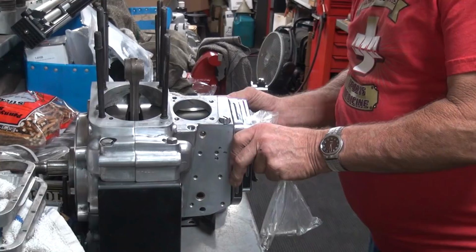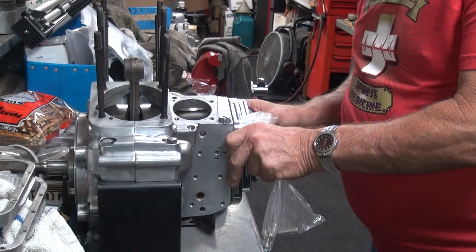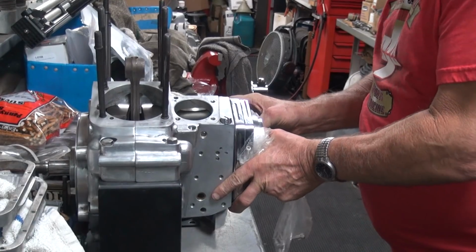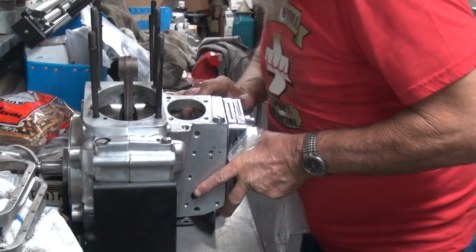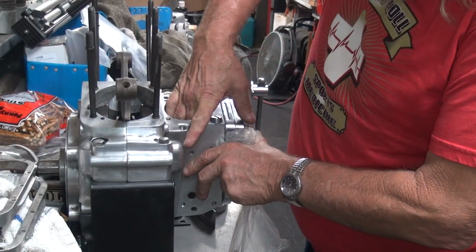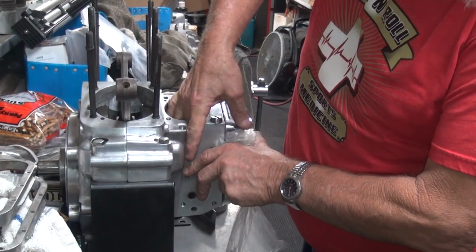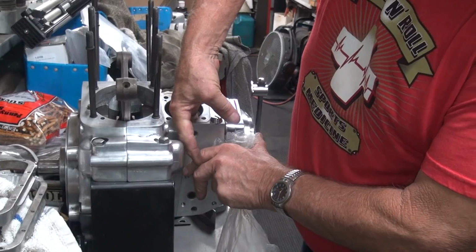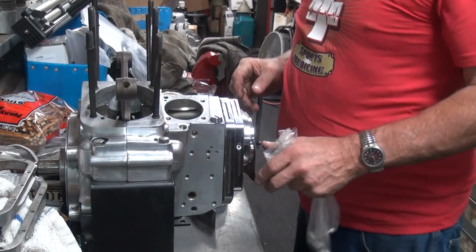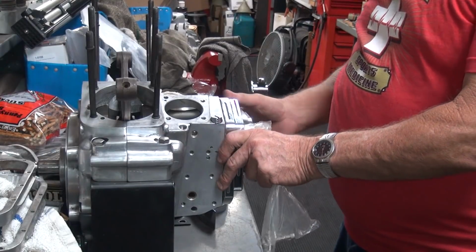That don't match though. The gears are different diameters. Are they? Yes. How much is your backlash? Don't take that off yet. Shove that back on straight. I don't know why you took the screws out of there. How much backlash is in that gear? Got a little backlash. A little or a lot? Yeah, it's probably the wrong gear, that's why. Well, at least it's not tight.